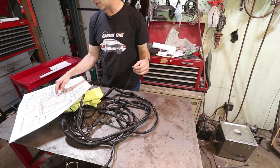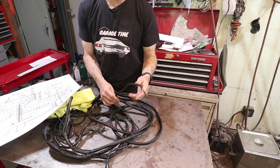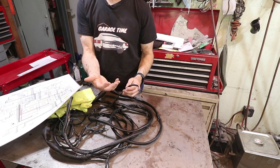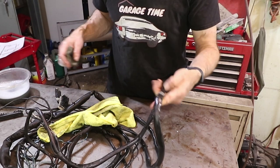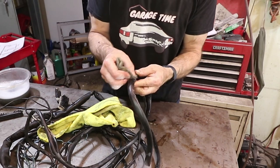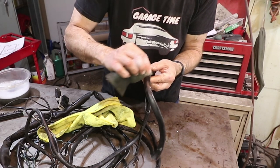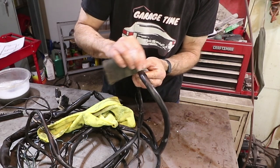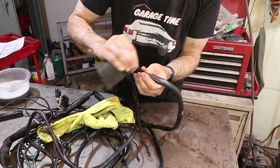This black and violet goes to the stoplight switch, which is why this is probably so dirty — it goes down underneath the car by the master cylinder. Here's a little overspray on one of the harness pieces I might try to save. So this is just a little bit of gray Scotch-Brite, and we just take our time and clear that off.